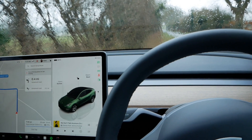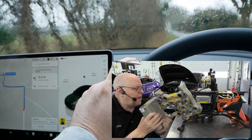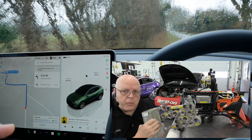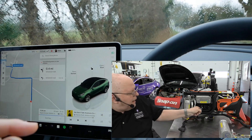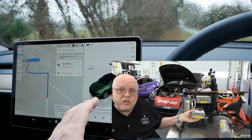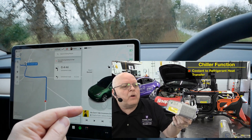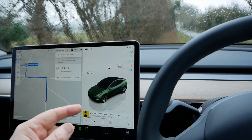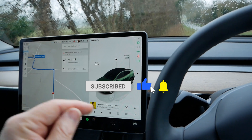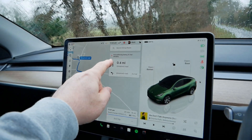Not only do these cars have a heat pump, they've also got something called an octavalve, and that's a very clever bit of kit that Teslas have. I'll put a link below to a video that shows you how the octavalve works - it's a long video but well worth a watch. On the Teslas, the way they scavenge heat from different parts of the powertrain is really interesting. They'll even run the inverters on the electric motors inefficiently to make the circuit boards hot, so they can generate more heat to put back into the battery pack or the cabin when it's really cold. It's very, very clever what Tesla are doing with their heat pump.